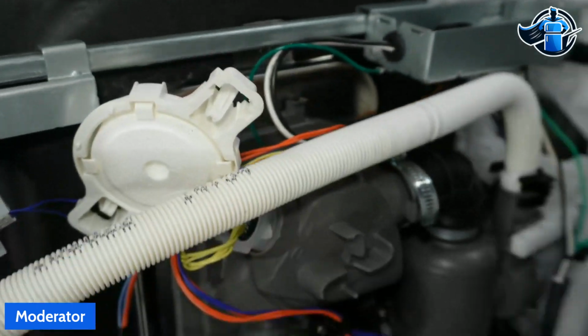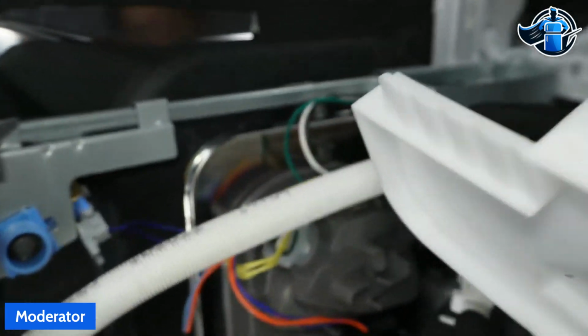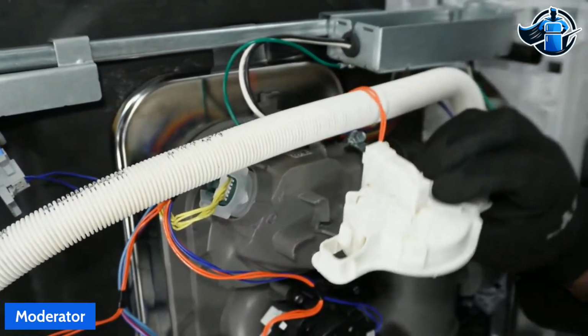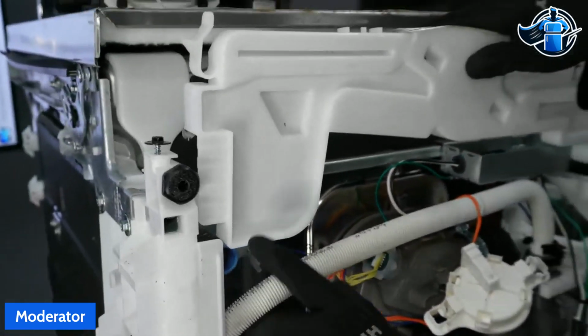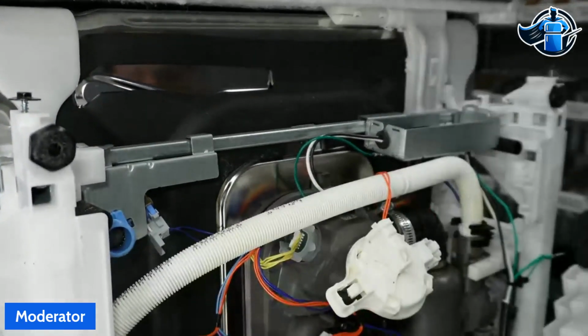So this tray, here is our float switch, styrofoam block, which engages our micro switch here. This is a normally closed switch. So once we activate it, it opens up the switch. So it kind of slides in. There's a track, and this whole system slides in place, and our float switch stays here.